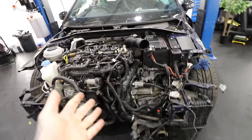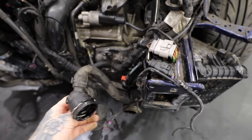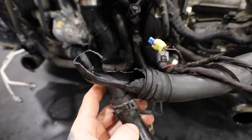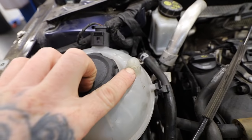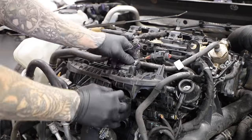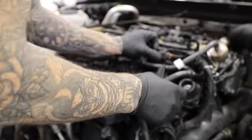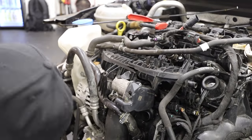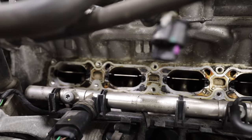On top of that, there's a broken plastic pipe with a damaged tab, a broken coolant line housing above the water pump, and a coolant reservoir with a broken tab — all had to be ordered. These small parts add up and make the repair more expensive than expected. The inlet manifold removal was quite tricky — lots of bolts, electrical connections, and vacuum lines all in fiddly locations. The throttle body has to come off the bottom before you can wiggle the manifold loose.